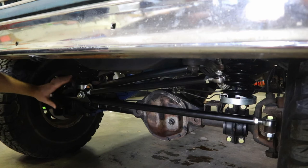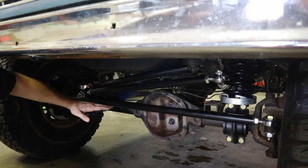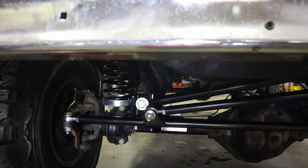I also want to show you that the steering is tie rod over. Tie rod over is for when you want to go over large obstacles — if you notice, the bar is above the axle tube, so your axle and pumpkin are going to hit obstacles before your steering does. Also, this particular riser bracket is designed to be used with a heavy-duty lower coil bucket. As you can see, there's plenty of clearance between the two, so you don't have to make any modifications.